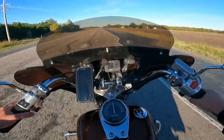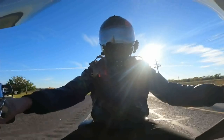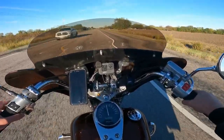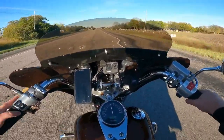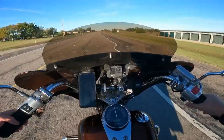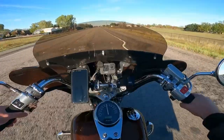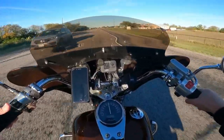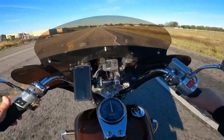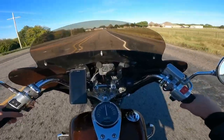The one downside that I would say about ABS, which I don't have in my cons list, and this would be the same with any four-wheel vehicle, is that it does prevent you from going into a skid, which is what it's meant to do. However, the only time that is an issue that I found is whenever you're traveling in a straight line and the car in front of you all of a sudden slams on their brakes. Typically that happens when someone pulls right in front of them and then immediately puts their brakes on because there's not enough distance between them and the car ahead. So in that instance, you're not going to be able to slam on the brakes and skid to a stop, even in a straight line, which would be the only time you would want to do anything like that if you had to. I mean, they actually teach that as emergency braking in the MSF course, and those bikes do not have ABS on them at all.